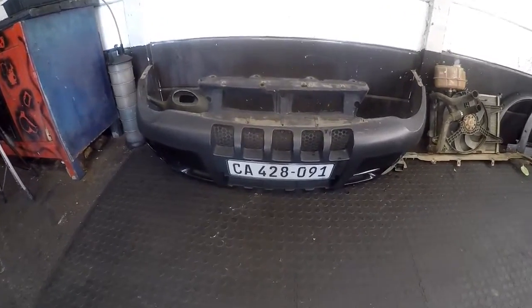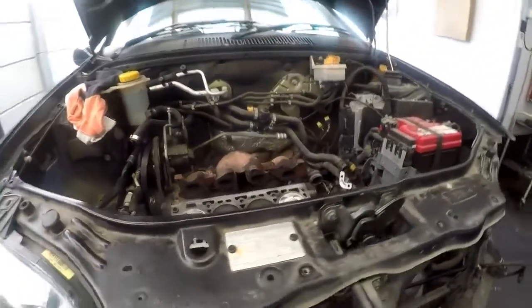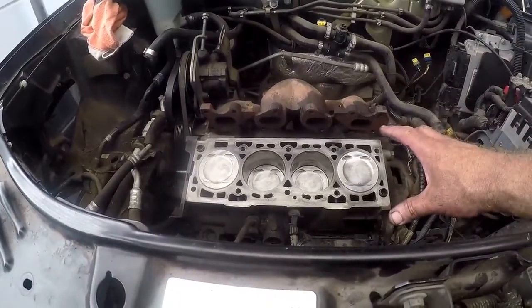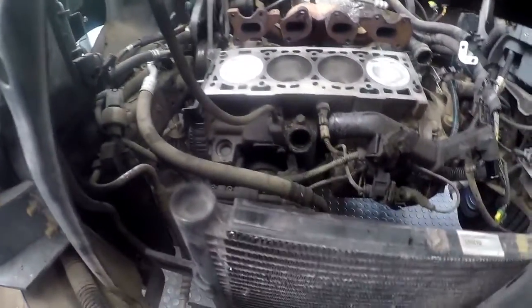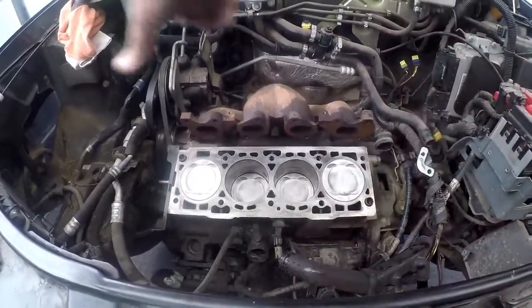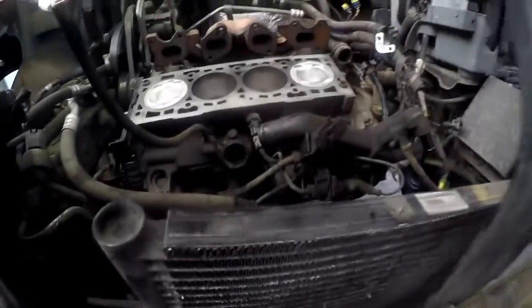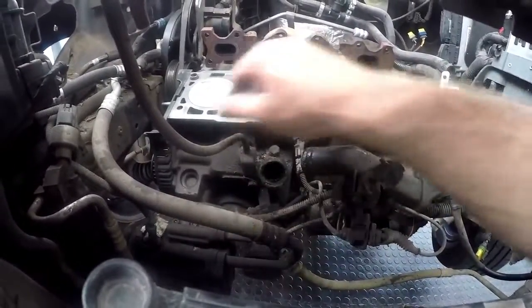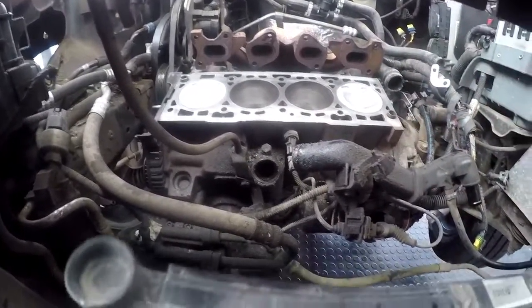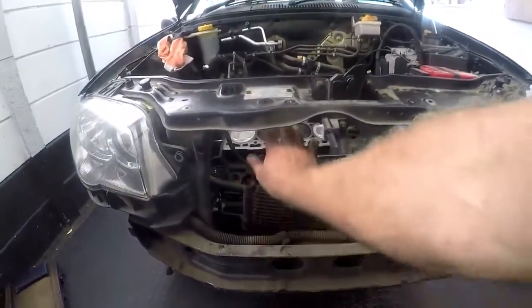I have stripped this vehicle — I had to take the bumper off, take the radiator unit out, and take the wheel arches out. The reason I had to do that is I discovered with this engine you actually cannot put it back without accessing this area. You have to put the cylinder head back first, then put the two cam boxes on, and then only you can put the manifold on. With the radiator in place, this area is completely covered, so you need that work area to tie up the intake manifolds. You have to strip the whole front of the vehicle down to gain access.